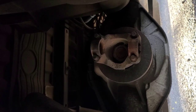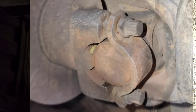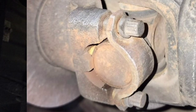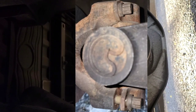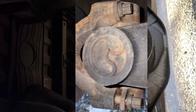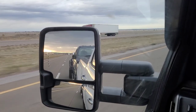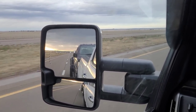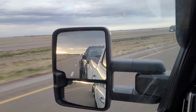One thing that really aggravated me: my buddy had just taken the truck to his local Ford dealership to have a rear main seal and oil pan gasket put on. When I went to pull the driveshaft, this is how I found it - they had to pull the transmission to replace the rear main seal and oil pan gasket, and they didn't tighten the bolts back up. Now, a couple of weeks later, that same dealer is telling him he's going to need a new engine. Was it the same technician who installed the driveshaft that did the work on the engine?